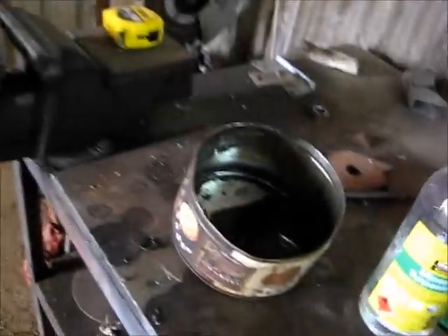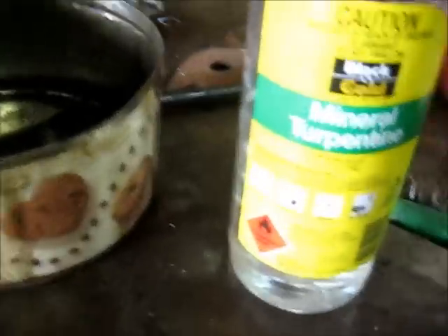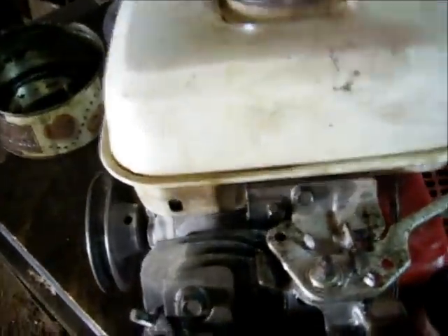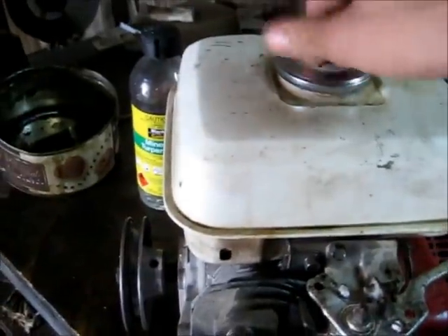It's a good thing no damage was done. Before I put all the final bits back on and before I start it, I'm gonna just flush the cylinder out with a little bit of mineral turpentine — help dislodge some of that carbon, there's a bloody lot of it in there. Just help get the excess oil out. It's not gonna hurt it, but mainly doing this because of the carbon deposits in there. It's just caked on like crazy. Running this thing on normal fuel just carbons the hell out of it.